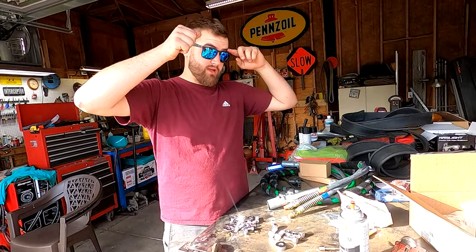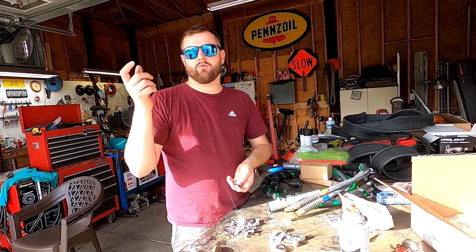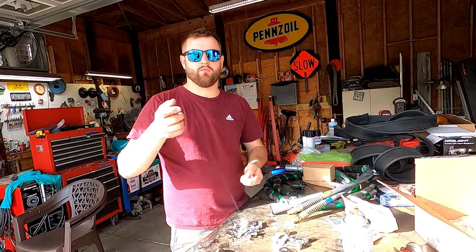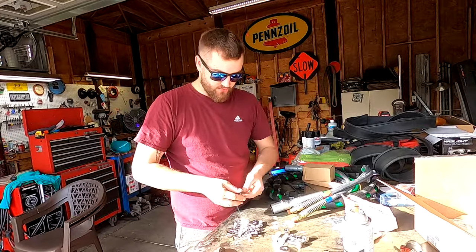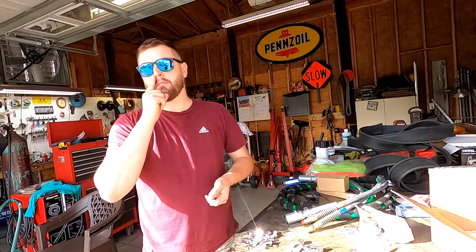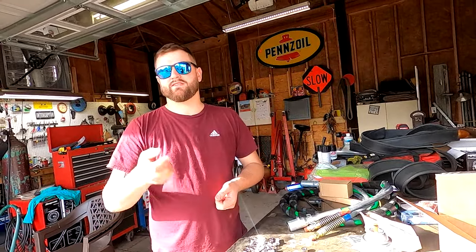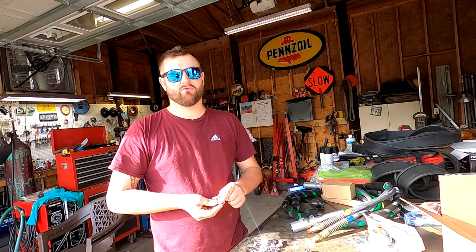And we're gonna bolt those up for now temporarily. And then after we get the truck mobile and stuff like that, we're going to weld them on when we get the bottom bracket on there too. So that being said, we're gonna get all the hardware to go bolt the air dryer up completely to where it's not gonna go anywhere and get it tightened down. And then we're gonna start getting these stacks set up there and getting them drilled.